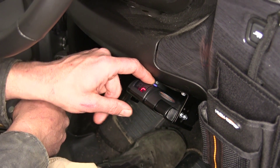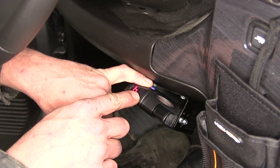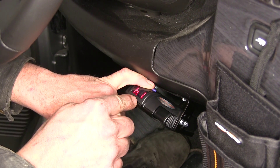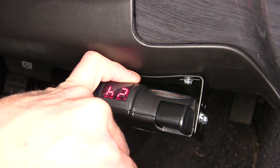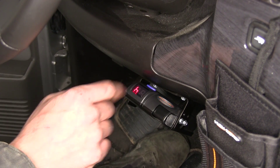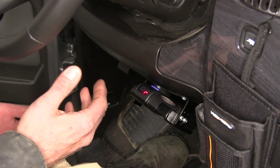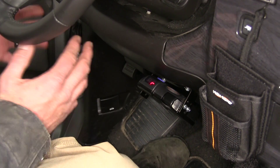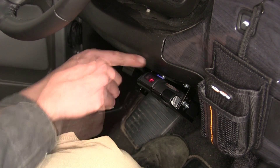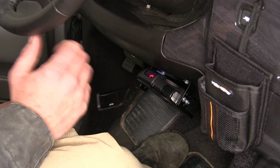Another great way of customizing is the boost control, right up here on top. You'll hit the button and it'll say B with nothing beside it — that means we don't have any boost on. Then we'll have B1, B2, and B3 before we go back to the boost being off. We raise that boost level depending on the weight of the trailer in relation to the vehicle — that's in the instructions, and it helps dial that in. That boost level is going to determine how quickly and aggressively our brakes are engaged.